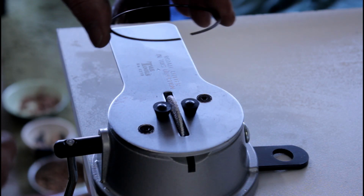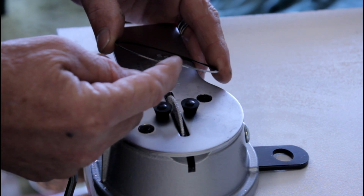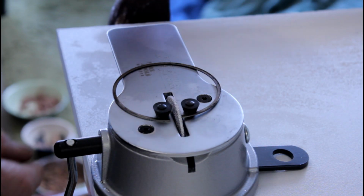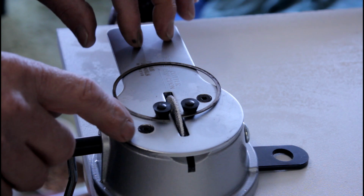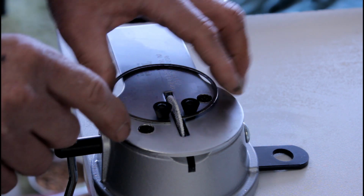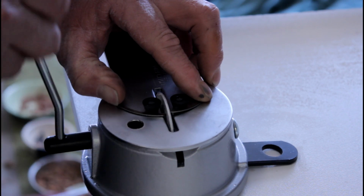And if we were to file it, we've got to be very careful, because this edge, these rings often have a coating on them, and you've got to be careful that you don't chip that coating. So when you file these things, even the manufacturer of this product recommends that you place them up against these tapered guides, these two pins, and you squeeze the ring together, and then you grind the ring like so. However,